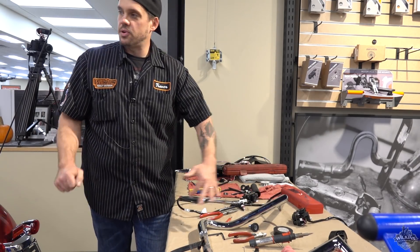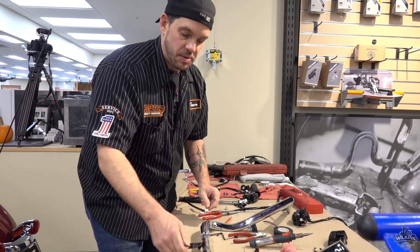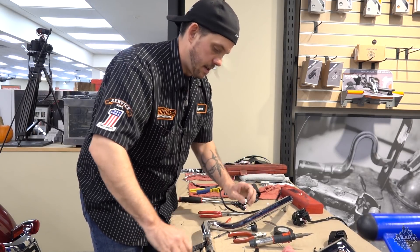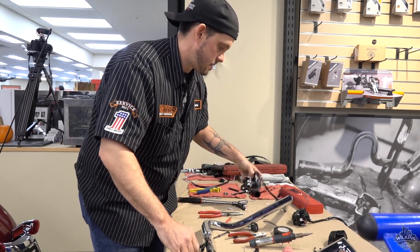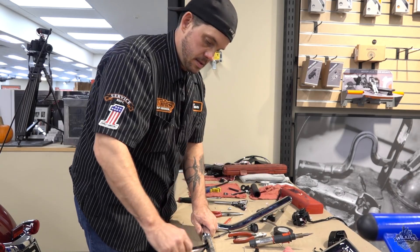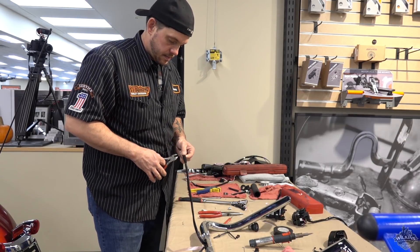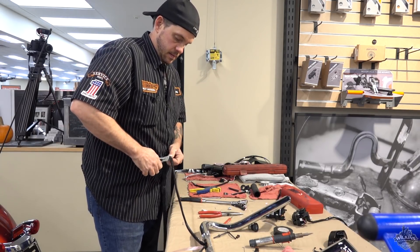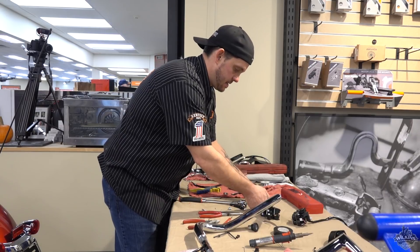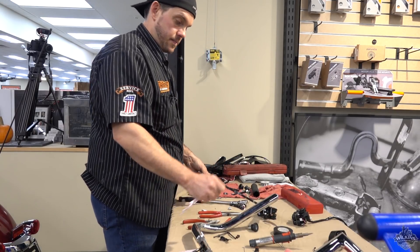On these Z-bars, it's easy to just push-pull, push-pull little by little to get it over that sharp edge. If you have trouble pulling these through with the string, then you know there might be a burr or something in there. These are going to go through nice — I'm already past it. Beautiful, look at that. Now if we can get that twist grip sensor through there, it's all smooth sailing. This might be the last thing that the snake pulls through, because that worked really well.